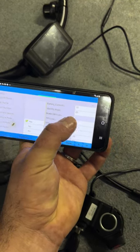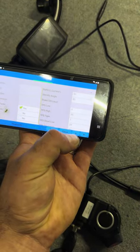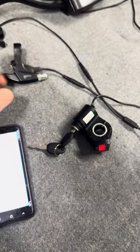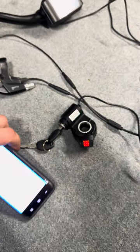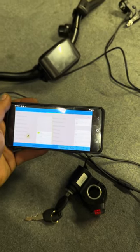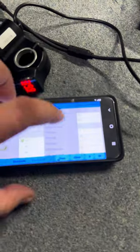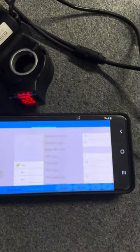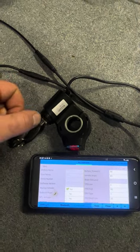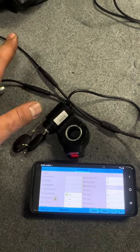What you need to do is go to where it says 'Identify Angle' and change the number to 170, then press Write. After pressing Write, press R to read the parameters again. If they've changed to 170, turn off your scooter from the ignition key, wait around five seconds, and after five seconds turn it back on. You'll see your motors start to spin just a very little — just a small pulse.